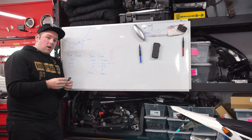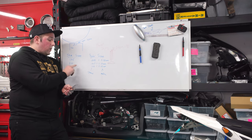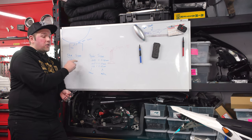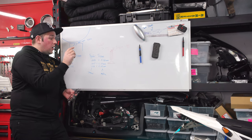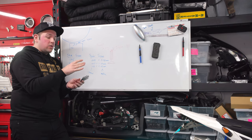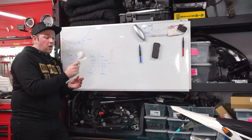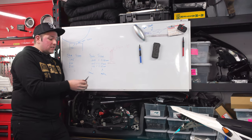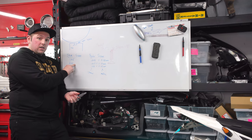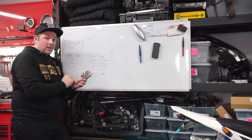Again, this is the rabbit hole I went down. A lot of numbers are being talked about, so I want to clarify what the numbers are real quick. If you hear us talking about a 1.95, a 2.00, a 2.02, these are shim sizes. These are the numbers that correlate with how thick our shim is. Now you're also going to hear us talk about feeler sizes. These correlate with our feeler gauge. This is where it got confusing for me, because when talking about the feeler gauge, we would call it 8 or 7 or 6. What we were referring to was, on our feeler gauge, a 0.006 feeler gauge, which corresponds to a metric size of 0.15. The numbers over here on the shim sizes are in metric. We kept referring to them in the standard sizes. That's where it got confusing.